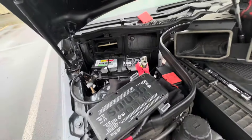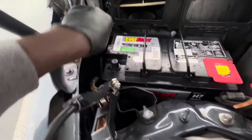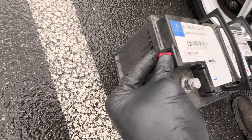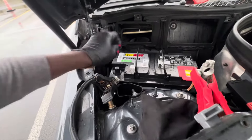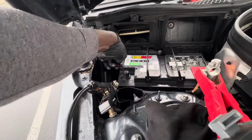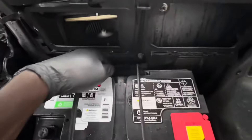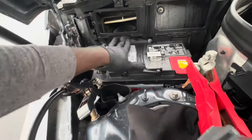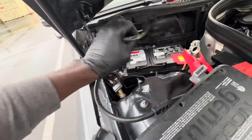Got the new battery in. Please don't forget to actually remove this thing from the side of the battery — this helps the battery breathe. It sticks into the side right there. Don't forget to do that — it's very important. Just slide that back in and connect the breathing tube. Set it in place — remember, it needs to be sitting inside the groove on the other side. Slide it in that direction, then put your frame back in.